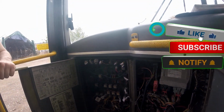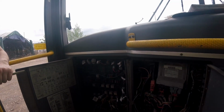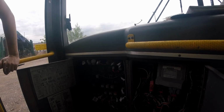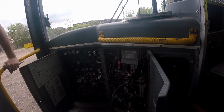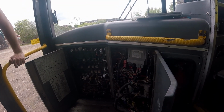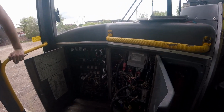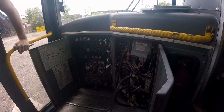What? Well, if that shorts out at the back. No, it won't. It'll be fine. It won't, because it's putting 24 volts down there constantly. Yeah, it's fine. So yeah, and the ignition is triggered by negative. Which also means now that when we turn the bus on, turn the key off at the front and turn it on at the front, the bus starts as it should.